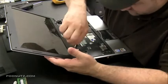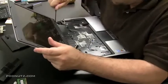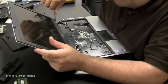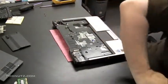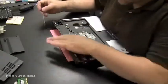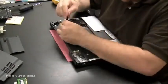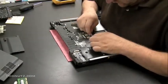The wireless antenna usually goes to the top of the screen, so it's not just the LCD cable connected to the screen. There are four screws on the top holding the screen in — it comes right off. Now I'm looking for any screw that appears to be holding the top plate together with the bottom plate. I want to unattach the top plate from the bottom plate so we can get to the motherboard, so let's look for every screw holding the two together.